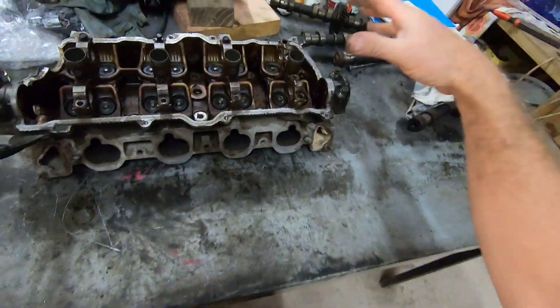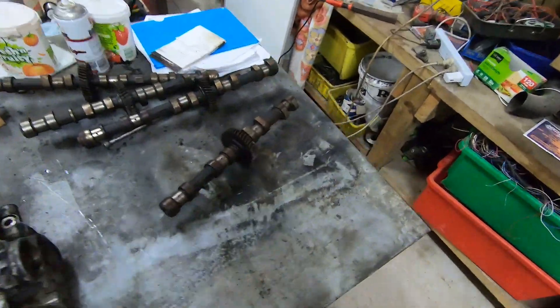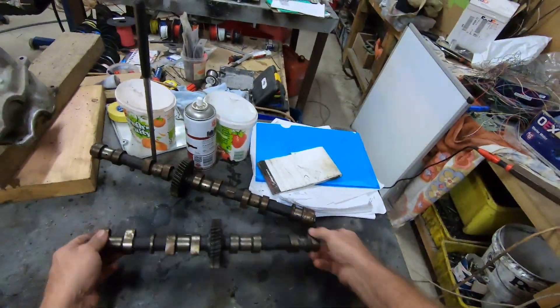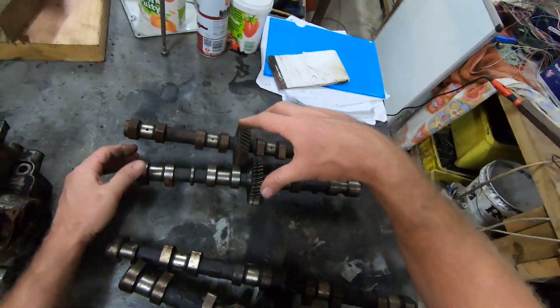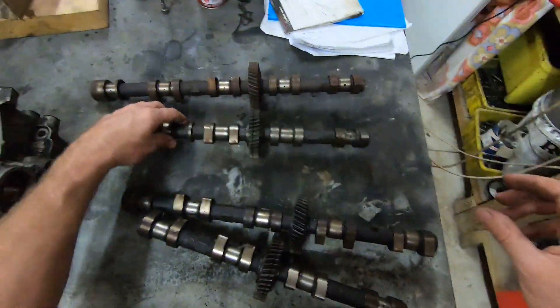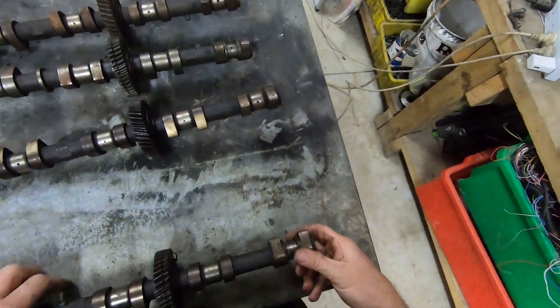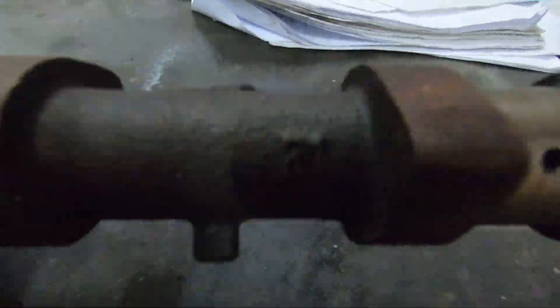Onto the camshafts. This is the bit that can be interchanged, but you do need to swap the camshafts around. I happen to have some spare camshafts here, and one day I will do a video on setting up the cam timing internally. On these camshafts we have the scissor gears — that's designed to stop the backlash and stop chatter. On the back of these cams there are some lettering to designate whereabouts in the engine they go: R1, R2, L3, and L4.